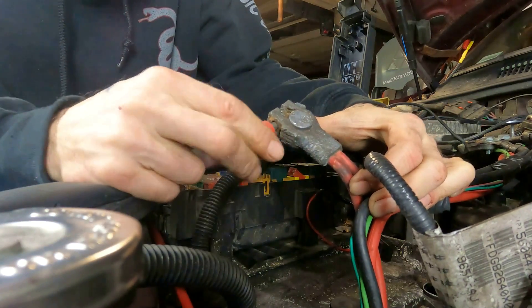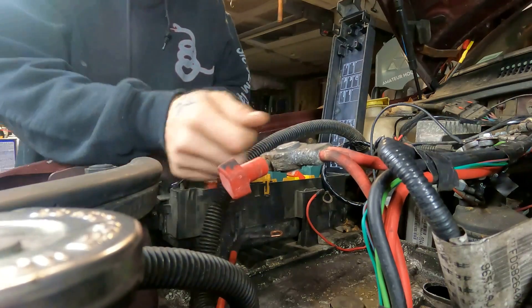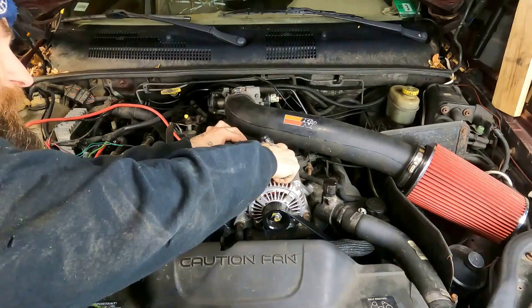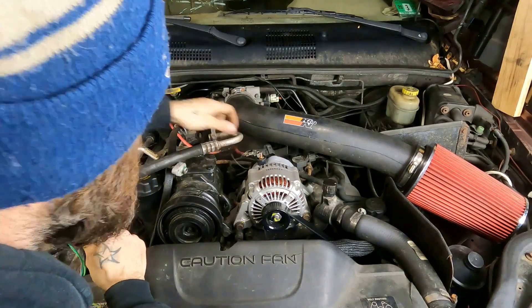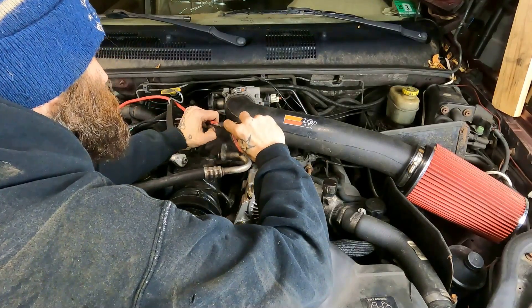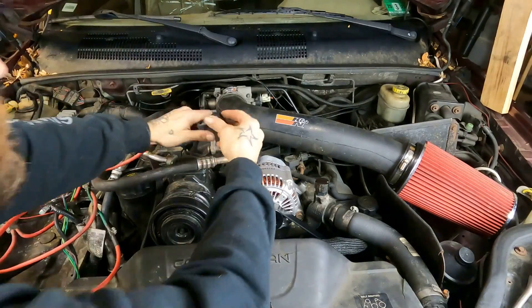What we're going to do is take this all the way back to the alternator and cut it. You can see this battery connector is severely haggard — this is actually a lawnmower toggle. We're going to cut it right there. The new ones I got from Wally World — the reason I got the bougie ones is because they had two 4-gauge ports for us to put the new wires in, which is what you want if you're not going to swage them in or solder them in. This is a new reman alternator — that last one was blown to bits. I had to get this one; it was hot too, oh my goodness. This cable is free at last.